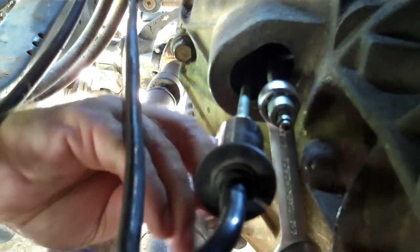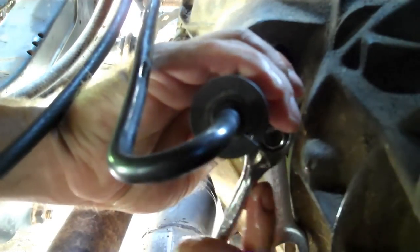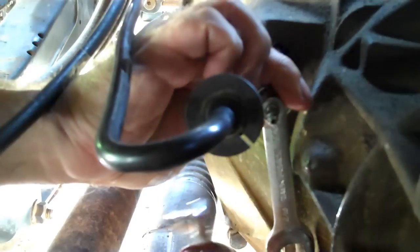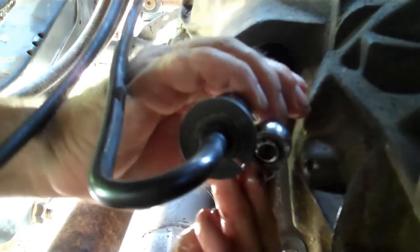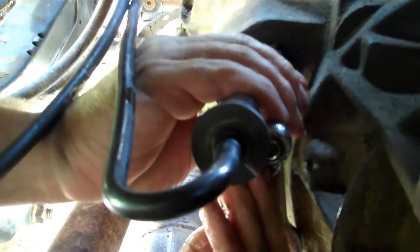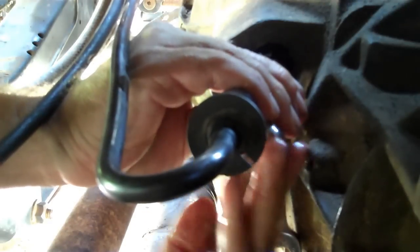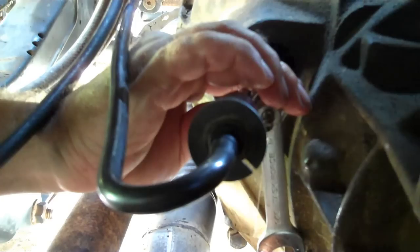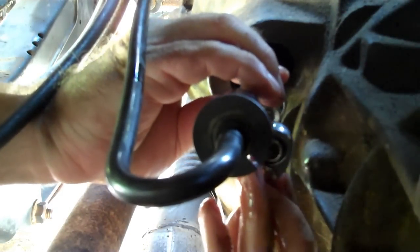Reverse the ratchet — he's still got the clutch pressed and has not turned loose yet. Crack this valve one more time — you see the fluid just come shooting out. Okay, now we're down to just a drip, which means the pressure is completely bled off the line. Brake fluid does not taste good, by the way.